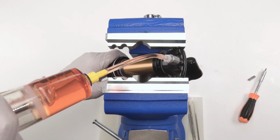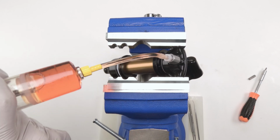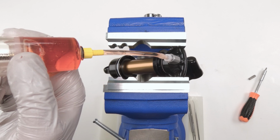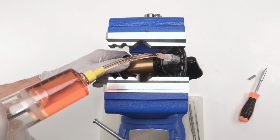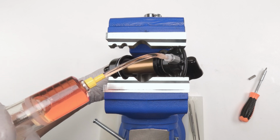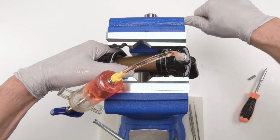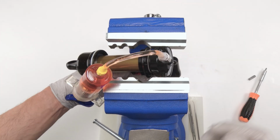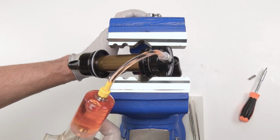Bring them out here. All right, there you go. Again, suck them out. Don't leave them inside. Make sure they go all the way to the top as well. All right, just when you think you're done, you're not. This is a very tricky shock. There's air that could get trapped in all sorts of spots. Let's lift them up again, press in the IFP. Oops. Stupid design. Okay, pressing up the IFP.